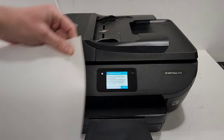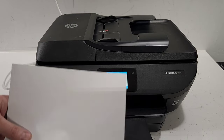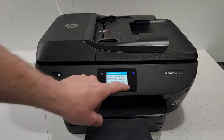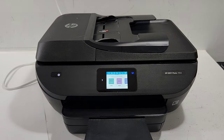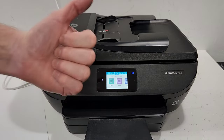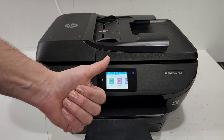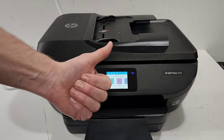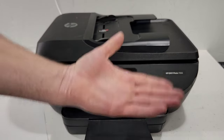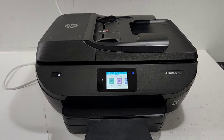My page was printing and it printed nothing, so most likely my ink cartridges are clogged. It says alignment unsuccessful. At this point the first thing we're going to talk about is the cartridges. You've got to make sure the cartridges are printing — the two main colors for an alignment to pass are a cyan cartridge, even if you have partially clogged yellow or magenta, and the black has to be fully 100% in order to pass the alignment test.